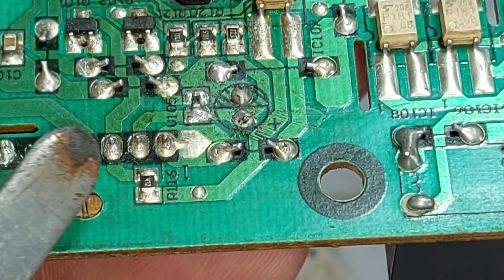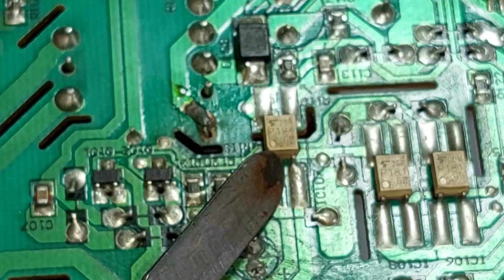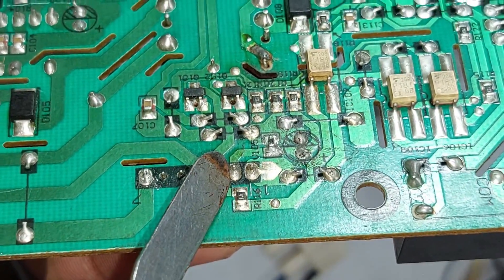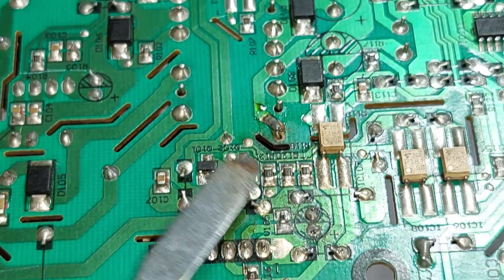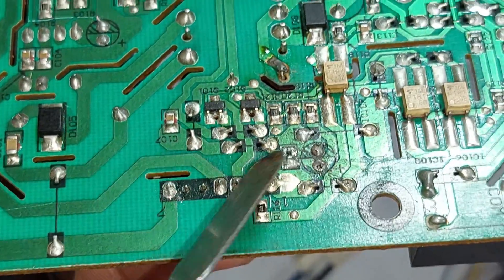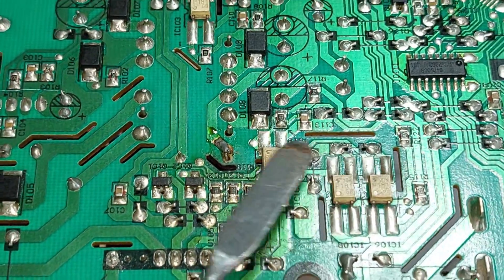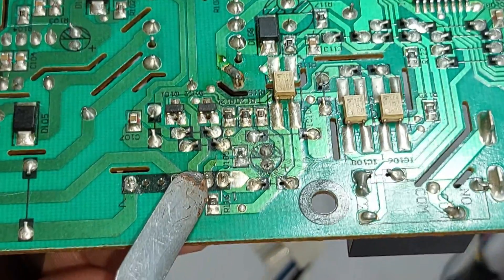There is another circuit here: the 15 volts from pin number 3 move towards a resistor, whose trace leads to another optocoupler. The two pins of this optocoupler are on the emitting diode side, and it tells the microcontroller that there is no problem with the voltages. The next connector pin controls and operates the speed of the motor, with voltages ranging from 3 to 7 volts. A PNP transistor is installed for this pin, and the same 15 volts pass through it. This transistor opens gradually to pass voltages to pin number 2, operated by an optocoupler which is also controlled by the microcontroller. When the optocoupler turns on, the transistor turns on, voltages start to pass, and as the transistor opens more the voltage keeps increasing — this is how the speed of the motor is controlled.